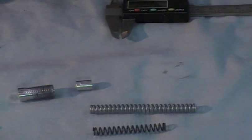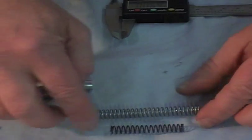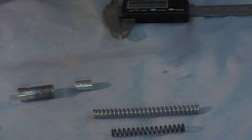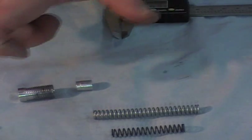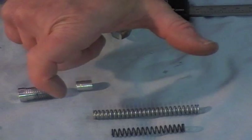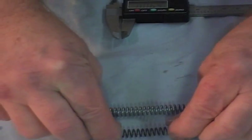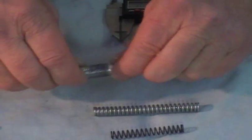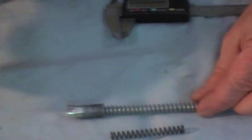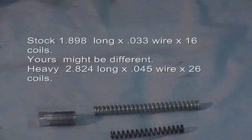Also the number of coils — the Disco spring has about 16 coils, and I've got about 26 coils in this one. Because of the increased stroke length, you're going to need more length and more coils, because when it compresses you're going to reach coil bind fairly quickly. I've got just a little spacer in here to make the rear velocity adjuster work correctly. I can use it without that to put less preload on the spring.